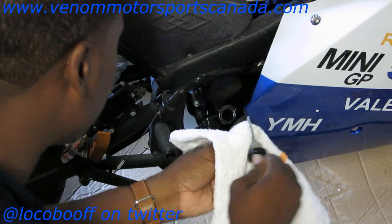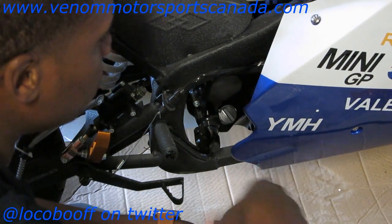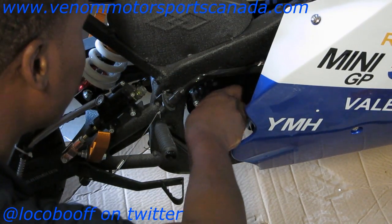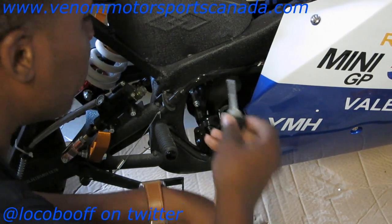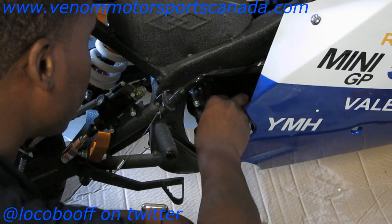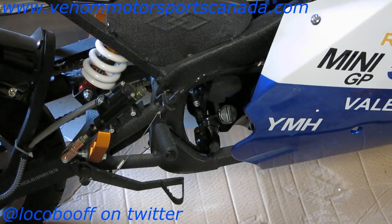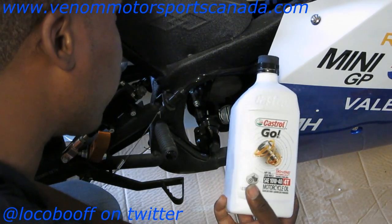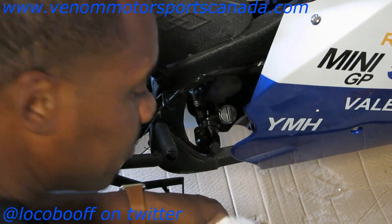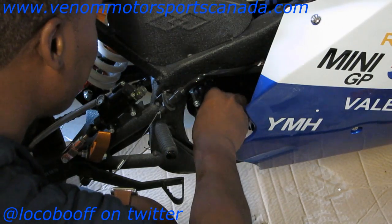Let's check the oil really quick and see if we have oil in the hash marks on the dipstick. Pop this back in. I have a how-to-change-oil video if you want to know how — there's a bolt directly under here, loosen that, the oil drains, and you add oil right here. I also have a video on how to change the spark plug. Looks a little glossy — I'll probably change it. Grab some motorcycle oil from your local automotive store; I use 10W-40 four-stroke motor oil. It only takes about three-quarters to fill it up.